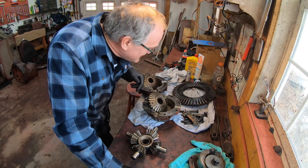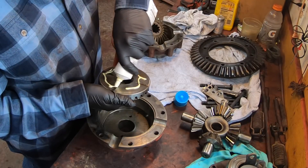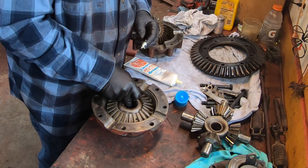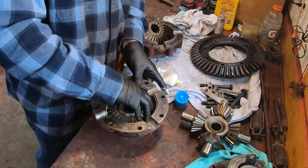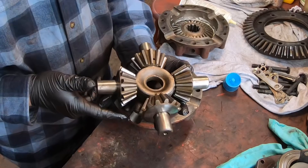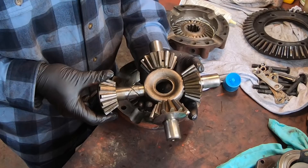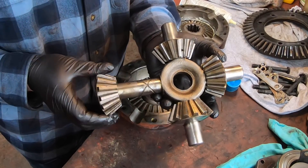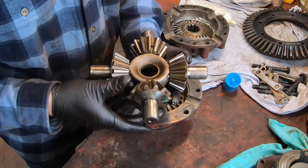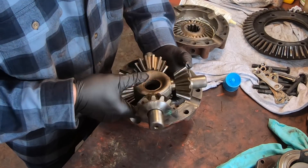Step one of the whole process is to reassemble the differential. I took it all apart and cleaned all the pieces up, so we're going to put it back together. Lube these up a little bit—these are a tight fit, got to get them in right. Next is the spider, and I kept track of which pinion gear went on which spider cross arm. There is some wear on these; here's where metal got in and did some damage, but I still have a good amount of tightness. It's not like I can go out and buy a new one, so I don't think this scoring is a deal breaker.